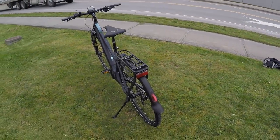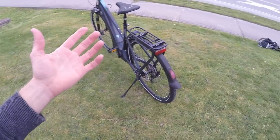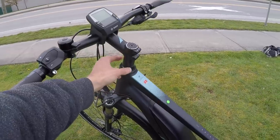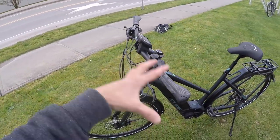The reach adjustment means you still have to go out to grab the lever, but it stays closer in — braking action happens fully extended, so you can generate good grabbing force. The fenders have a rubber flap at the rear with a little bit of wiggle, but plastic fenders can get bumped without getting permanently bent like alloy, they won't weigh as much, and they won't rust like steel — perfect for Canada where it rains. The head tube appears to be tapered, and Jason confirms it is, so you could potentially upgrade the suspension fork to something like a carbon fiber air fork if you wanted.